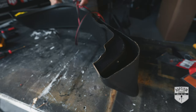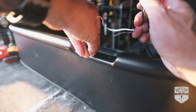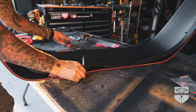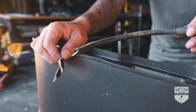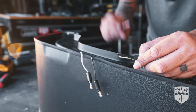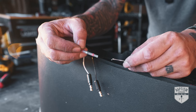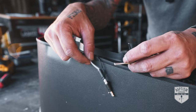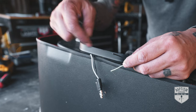To prep the front fenders — same as before — add the rubber strip to the edge that will touch the paint of your vehicle and peel a little bit of the adhesive backing to get it started. Once that's done, we have to install the side marker lights. Run the wire through the middle hole and with a long socket extension, hold the bolt in place inside the fender as you tighten it from the outside. Then get these wires and plug them to the connector that goes to the Jeep — this goes into the Jeep, and this goes to your side marker. I actually prefer using solder butt connectors over the regular butt connectors they provide. You join it, use a heat gun, and it melts the connection together. Here's something I learned the first time: it's actually backwards. Don't do black to black and white to white — when I did it, I found that black goes to white and white goes to black. You'll have to test yours, but that's what worked for me.